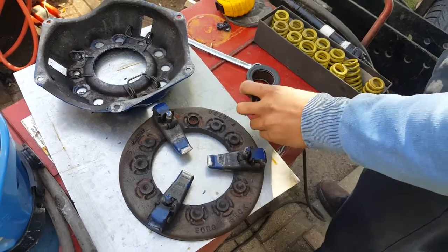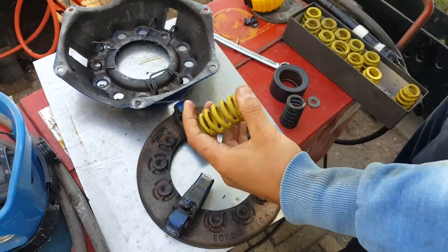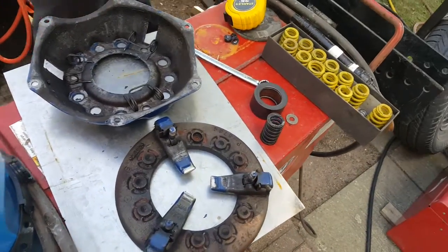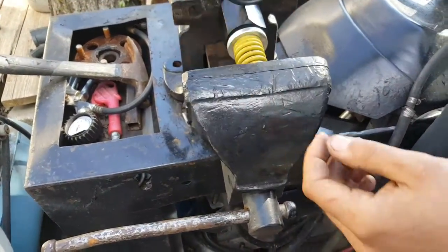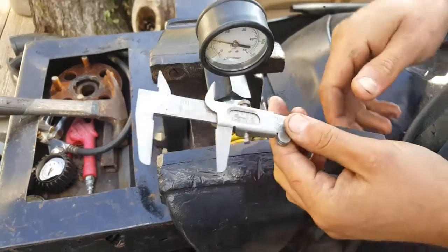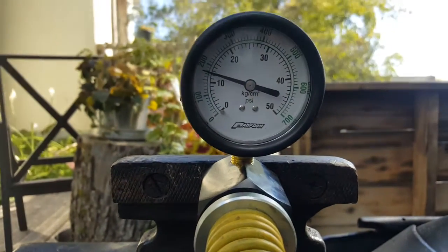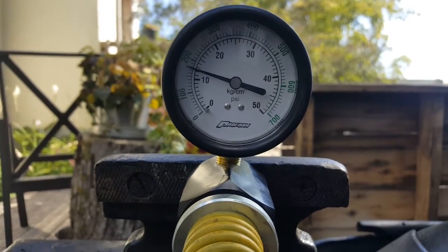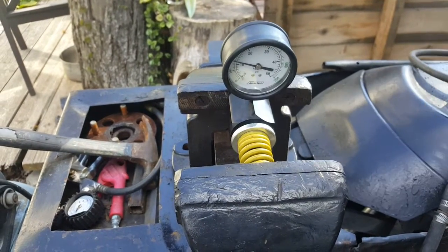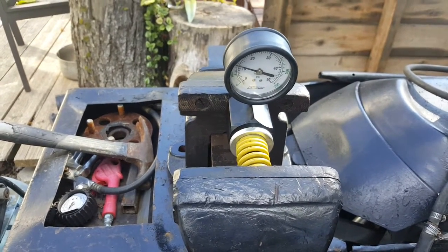It's sort of trial and error. I don't know if just replacing with these springs — which happen to be valve springs I had — will be enough. I'll show you what the pressure gauge looks like. I use my Vernier dial and compress the spring until it's at 1.5 inches. The force gauge shows we're at about 180 pounds of force. So it's still weaker than the required 230. However, I'm going to put 3 extra springs, which should compensate, but we might still have to change all springs to a stronger spring.